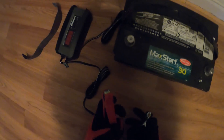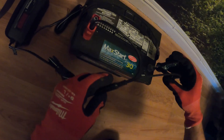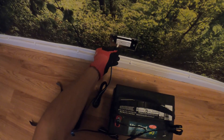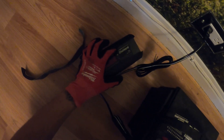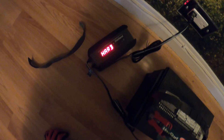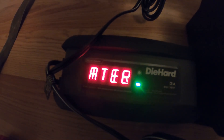We've sanded both of these connections down so we have a good connection for connectivity. We're going to put our red probe on positive and the black on negative — this is color coded. Then we're just going to plug this in and start this. It says: analyzing battery.